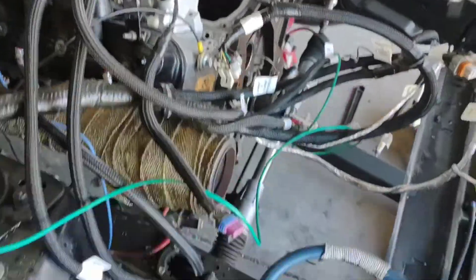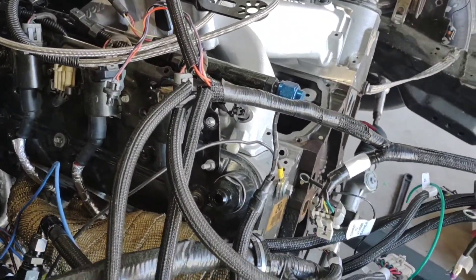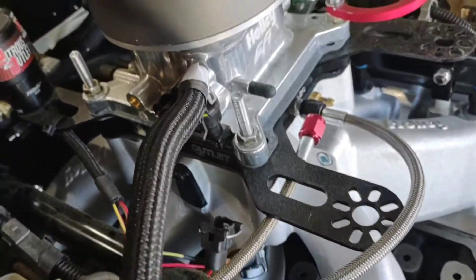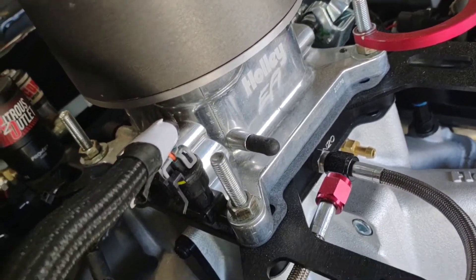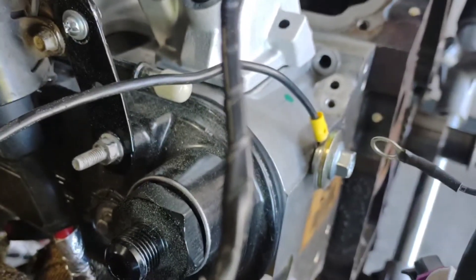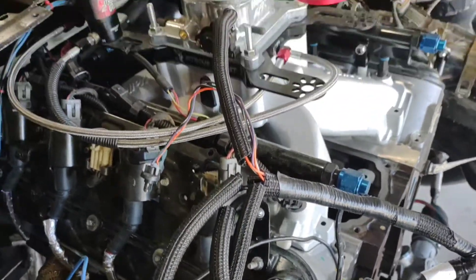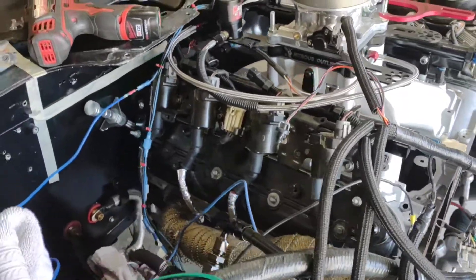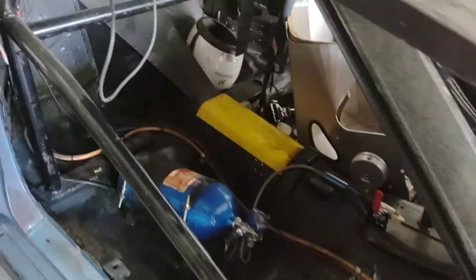As you can see, it's a mess, and that's fine. It'll look a lot nicer once I finish cleaning it up. What I did to start with was plug my TPS sensor into my Holley throttle body. I made sure that my engine was grounded and that my solenoids had a good ground as well. I don't have anything else hooked up from the Holley to the motor right now because this is the mock-up motor. The only part of the Holley that's hooked up is the nitrous and the purge solenoid.